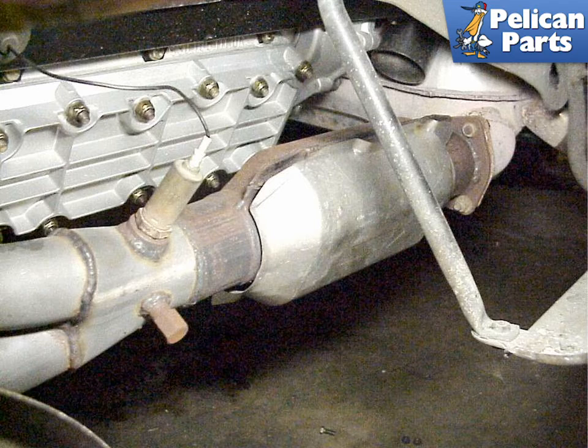You should also check your O2 sensor and make sure it has not failed. That can cause the car to run very rich, which will just start damaging your newly replaced and very expensive cat.